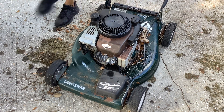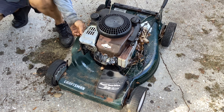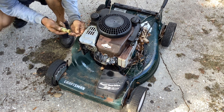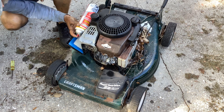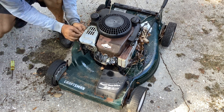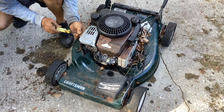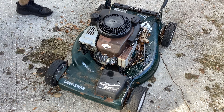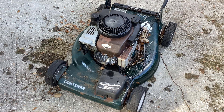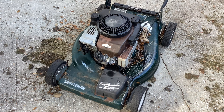Okay, it fired off. So let me try this again. The issue is it may need a new carb — it did have a lot of white crusty crud in it and I really spent some time with a pick getting rid of that crud under the bowl, making sure the passages were free and clear. Sometimes they are so bad after sitting for years that there's nothing you can do but put it in an ultrasonic cleaner. In the meantime I'll just put an aftermarket carb on and clean this one at a later date.